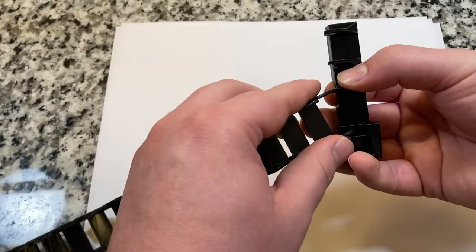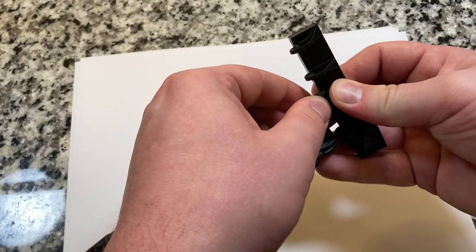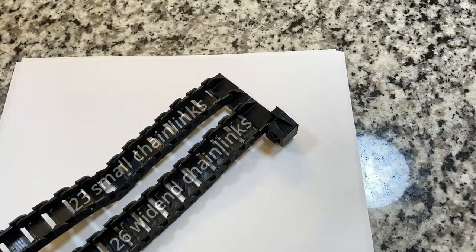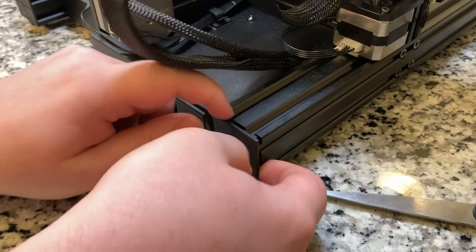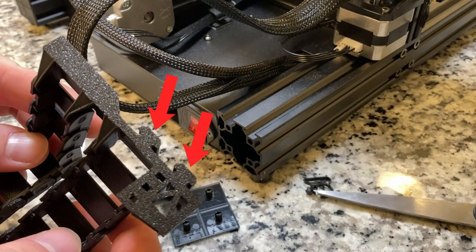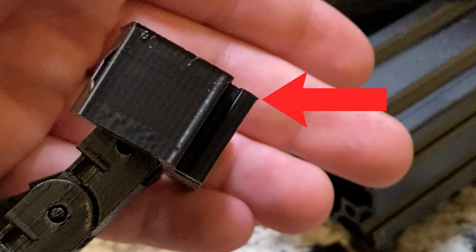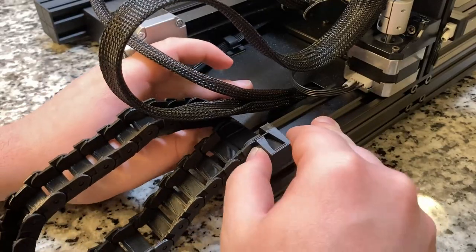Now onto the PSU split. Attach your 26-link long and 23-link long chain to this part, with the open side facing up. These chains are different widths, and so are the two chain connectors on this part, so make sure you're putting them in the correct place. Cut off the pre-existing zip ties, remove the end cap near the power button, and line up the slots on the part with the slots on the printer. These tolerances are very tight, and since my first layer was a little wider than the rest, I needed to sand off some material to make it fit. Once it fits, slide it on until it's about halfway between the z-axis motor and the back of the printer.